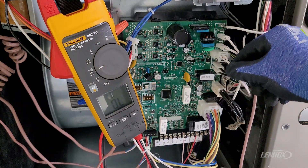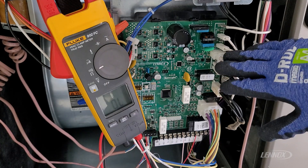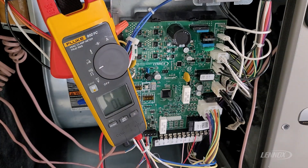The first step is to pull the plug at the board and ohm it there. There's also another spot further up the wiring bundle — another Molex plug connection point — and it's always a good idea to check that point as well to make sure there's no break in the harness from the board up to our igniter. We'll move the camera to show that second connection point.